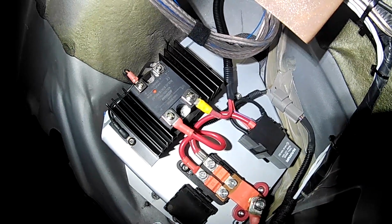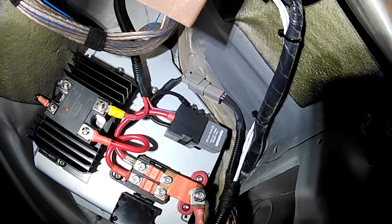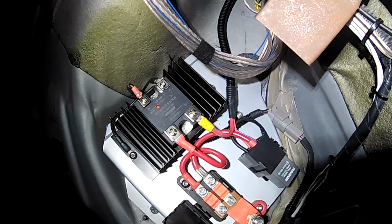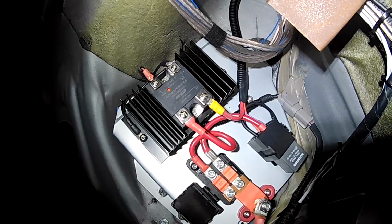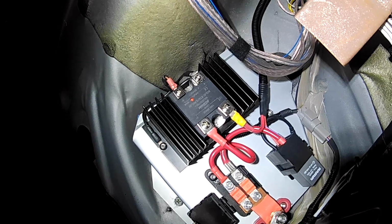It'll run all the time, but at a certain point, the second pump will be triggered to come in when the car's on boost above a certain RPM, all that sort of stuff. But basically, the solid state relay will be controlling the main pump.